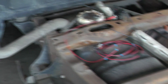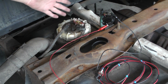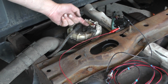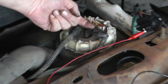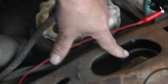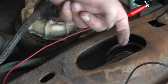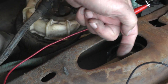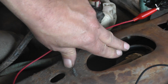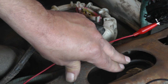Here's where our fuel pump and sending unit is located. These two lines right here — one's the supply line, turned at 90 degrees. Fuel is being pumped out and comes back in as a return line. Over here is a tank vent valve, which allows gasoline vapors to exit out of the tank through a little orifice, come down this hose, and go all the way back to the charcoal canister where they're stored. Then through a purge solenoid, the PCM determines when it wants to pull fuel vapors out of the charcoal canister.